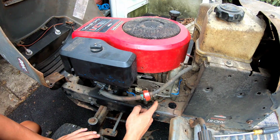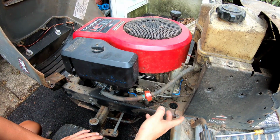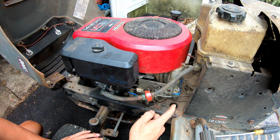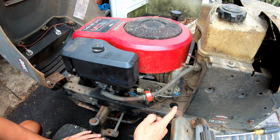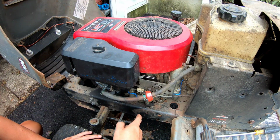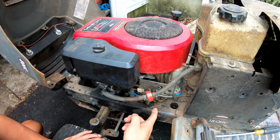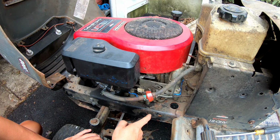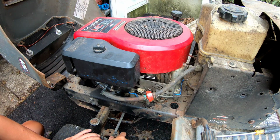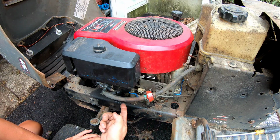I know some of you might have been saying in the previous episode, when I took the engine, flipped it upside down, removed the sump cover, and merely put a blue RTV gasket maker over the existing trashed gasket, you probably said to yourself, "Hey Henry, that ain't gonna work, it's gonna leak." Well, I've done it like 5 times on probably a dozen or so engine builds, and I've never had a leak. And here it is. The proof is in the pudding.